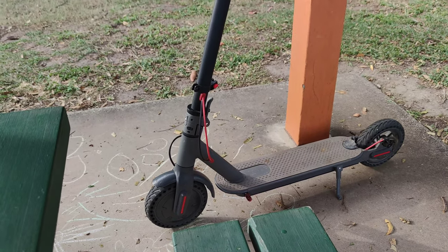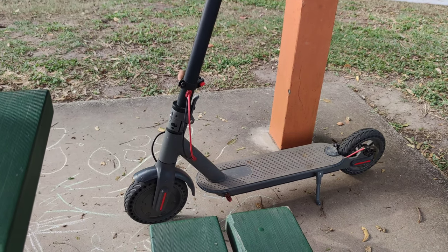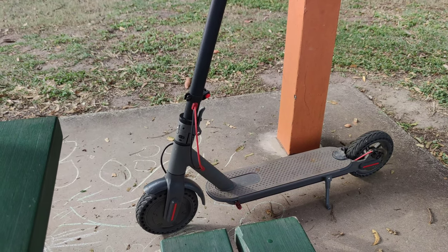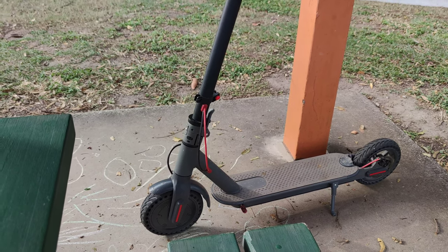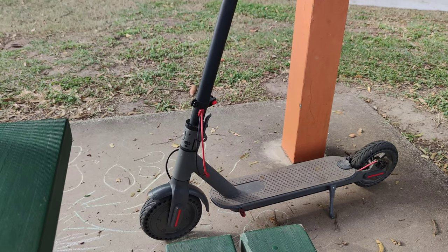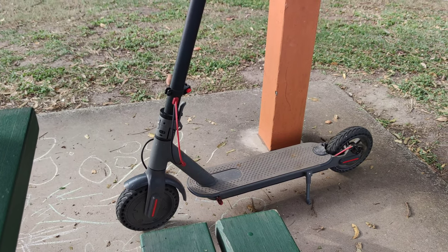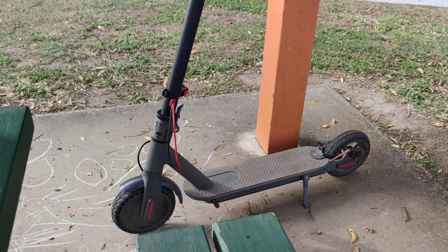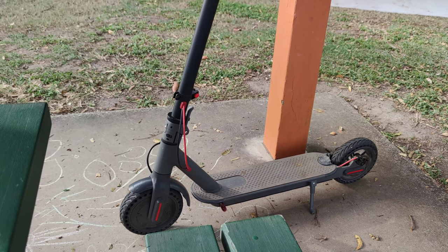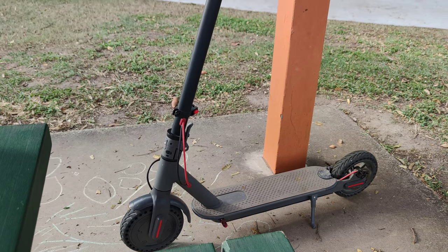At about 90 to 100 kilograms, I could reliably run around 30 amps without getting too hot. But the best thing to do with your standard scooter is stick with 10 or 15 amps through your 36-volt battery — that should be reliable and probably won't break unless you're constantly going up hills. These are my thoughts on keeping your scooter healthy and running it without excessive heat damage.